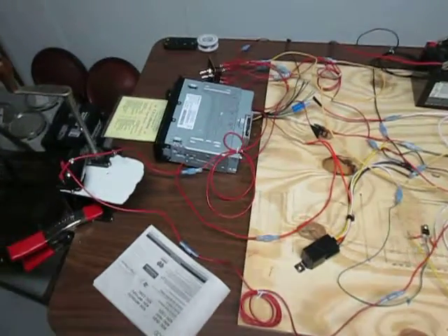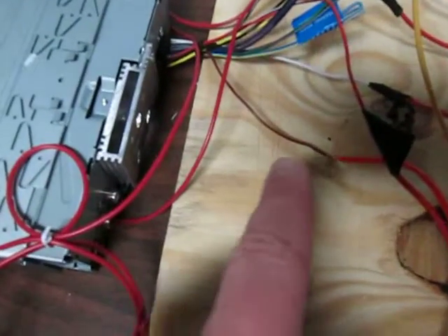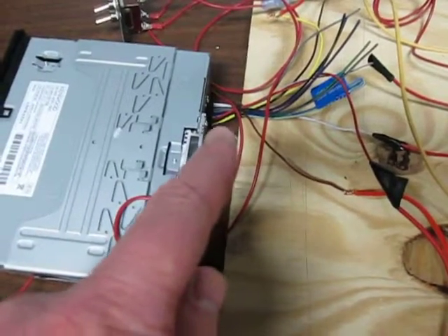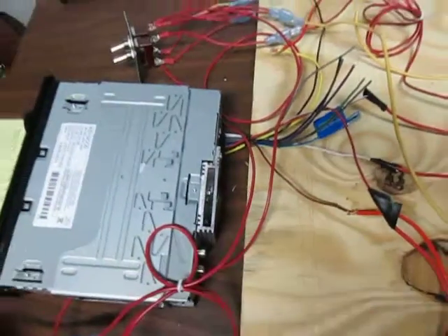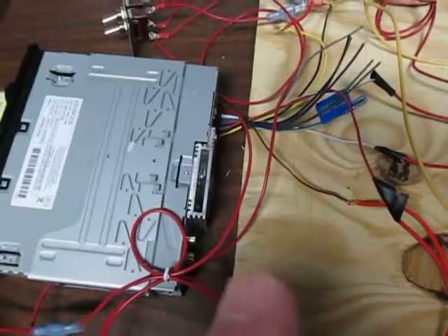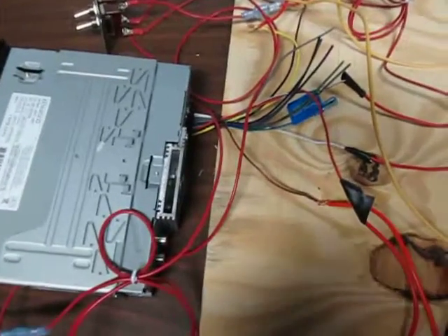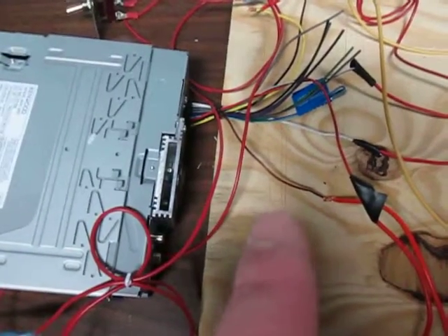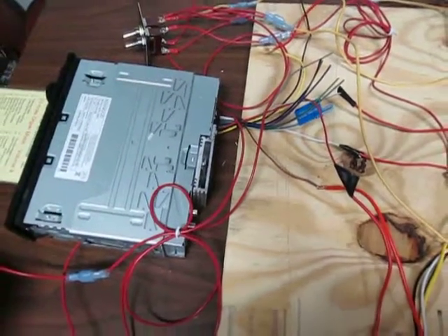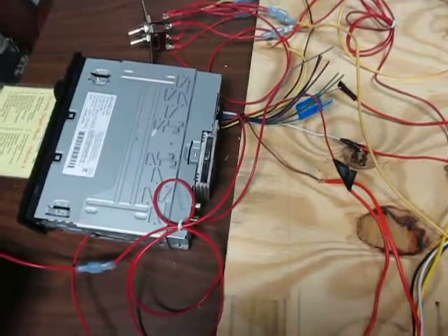To try and get around that, I found a radio that has a brown mute wire in addition to the usual yellow constant power and red accessory wire. What I was doing before is cutting the power to the red accessory wire to completely turn off the radio to make it stop playing. Now with the use of this brown mute wire, the radio stays on — it just goes into a call mode, which essentially mutes the radio so people can receive phone calls instead of having the radio playing at the same time.